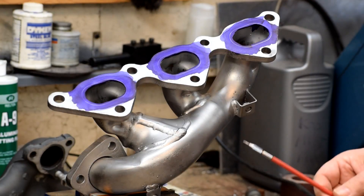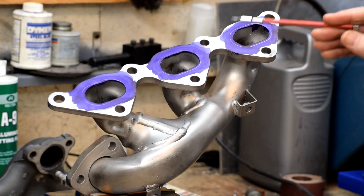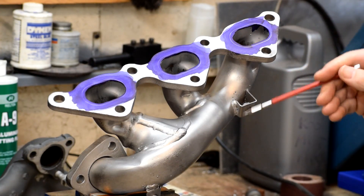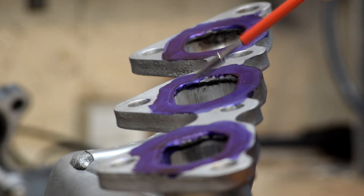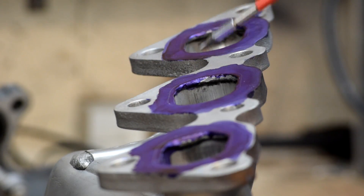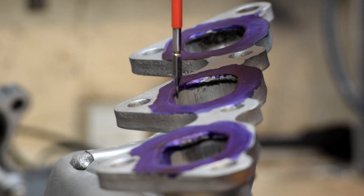It's full of these little clearance bumps, but I'm not too worried about those — if you've seen the Motor Trend Engine Masters TV series episode where they beat the crap out of a header, it turns out those little dents don't affect much. But there are areas along the flanges that need to be cleaned up, and there are areas along the inside which are really surprising. They've welded this steel tube to this flange on the backside, and there's a significant weld bead overhang over the inside of the tubing all along this edge. You can see where the scribe line shows where the exhaust manifold gasket goes and all that lump is extra weld — there's been no attempt to grind that off or machine it down. That's a significant intrusion into flow that just needs to get cut back and ground off.